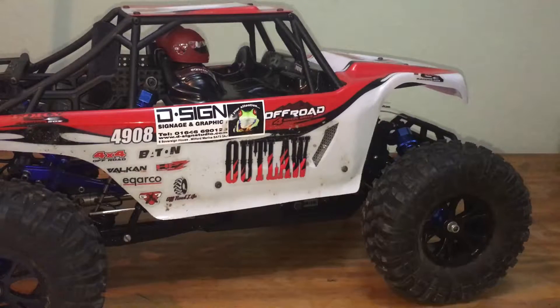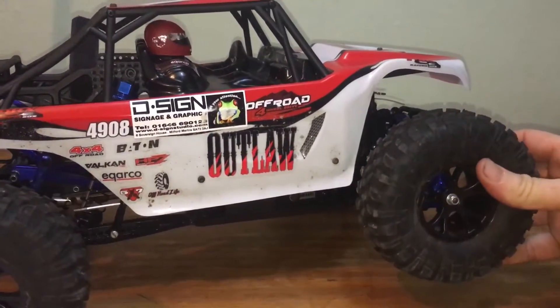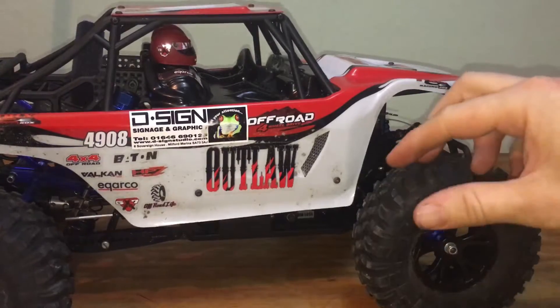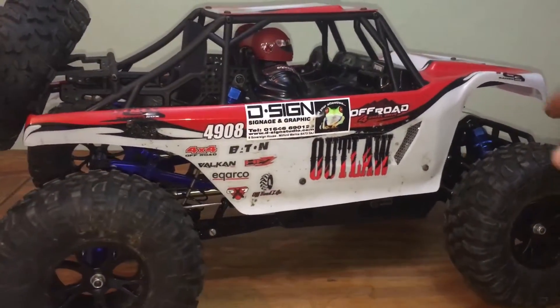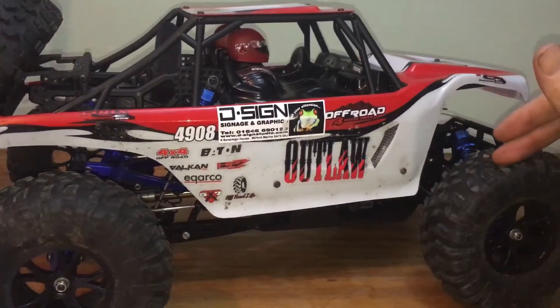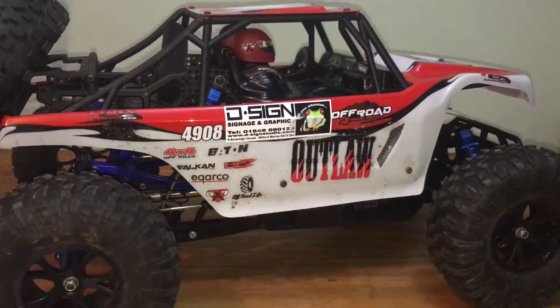So effectively it then becomes just two-wheel drive. Let me explain. The common way a differential works on cars is to spin the easiest wheel on that axle. So with one wheel off the ground - which is the front right-hand wheel in this case - its neighbouring wheel, the front left-hand wheel, will not receive any drive. This basically renders the car to be just two-wheel drive on the rear, and of course driving the front offside wheel. So pointless - and it's difficult to control at high speeds.